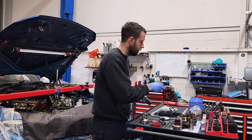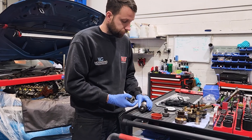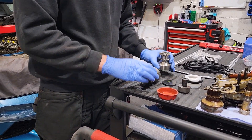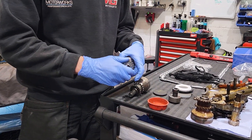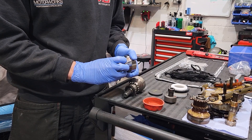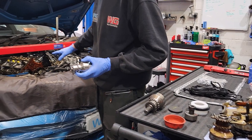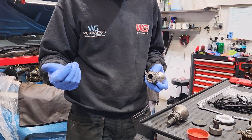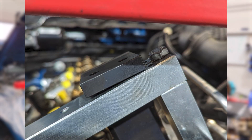The full fix, the best way, is a one-piece hub. With a one-piece hub, you have no problems with any of the individual components slipping. You've got two timing gears — one runs your oil pump, one runs the actual camshaft. When these slip out of alignment, your camshafts are out, you're going to get a check engine light thrown, as this one has. I've also got a picture showing where the timing is out.